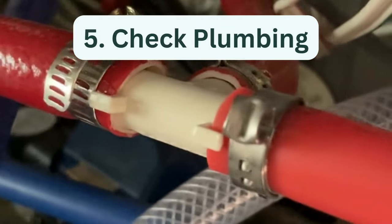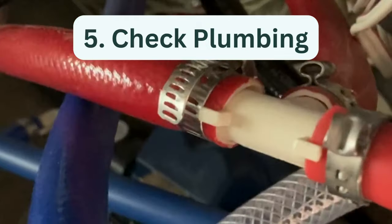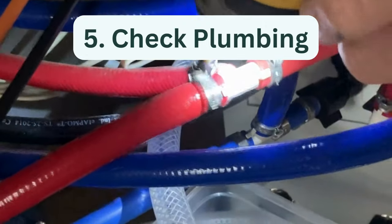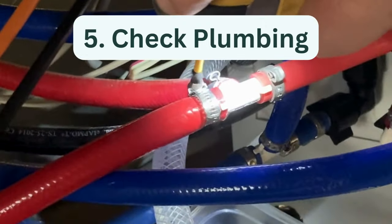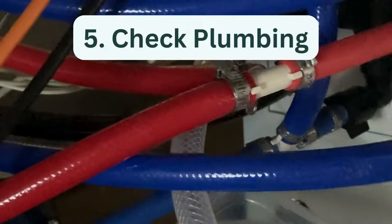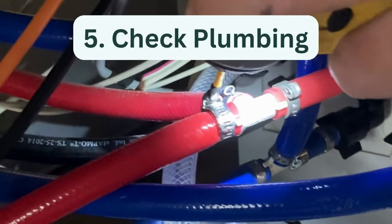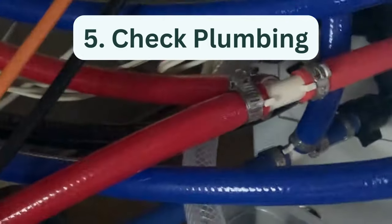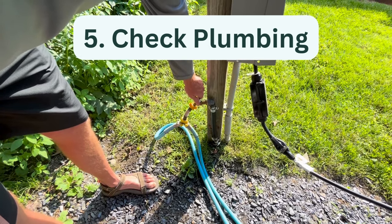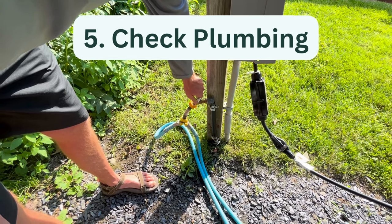Five, check plumbing connections. The plumbing line connections in RVs are attached with clamps. These clamps can easily come loose during travel or due to high water pressure. Once a clamp detaches, water will flow out and can cause a major flood. These fittings should be checked regularly to ensure they are tight and undamaged. Carry extra clamps and a PEX crimping tool in your RV to repair any loose connections. It is always a good idea to turn off your water pump or the city water before leaving your RV. If a leak happens when you are away from your camper, it can turn disastrous quickly.